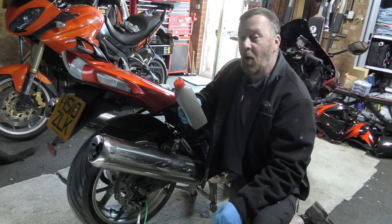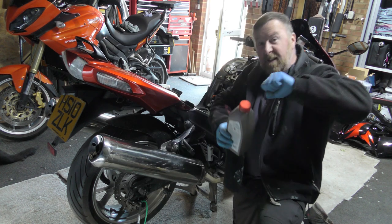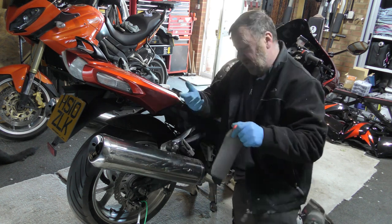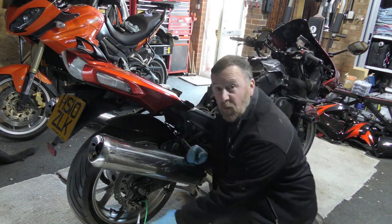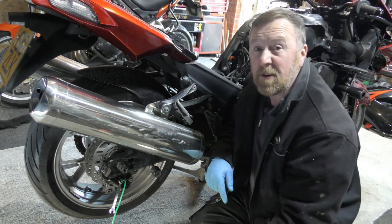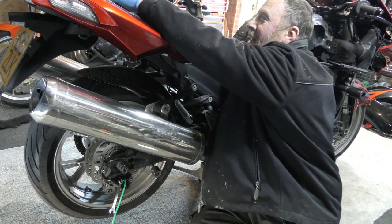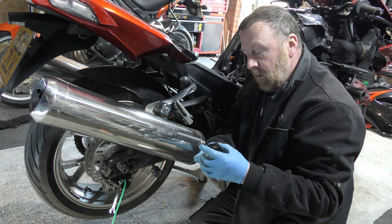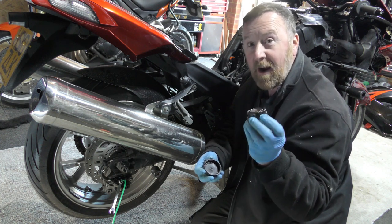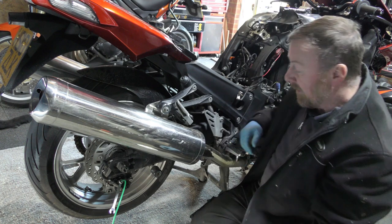We're hammering along today. The oil is out - the filter was a bit of a challenge. The filter removal tool kept slipping so I did it the old-fashioned way - put a screwdriver through it and got it off. It had been on there some time, believe me. The oil is still dripping out now. For the brake bleeding - DOT 4, doesn't matter what brand. Keep the reservoir at maximum. The only rule I'll give you: brake fluid loves paint but the paint doesn't love it. Do not drip this on your paintwork - it will take the lacquer off and ruin it.